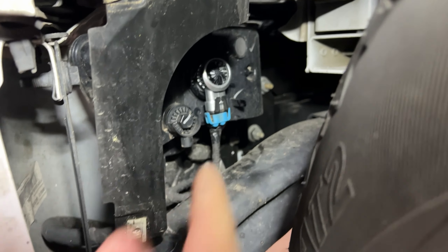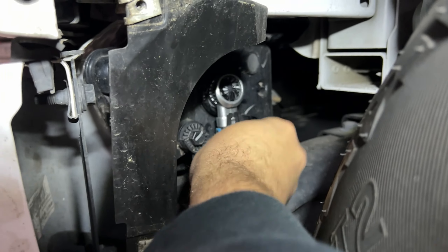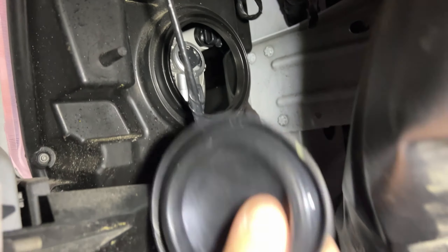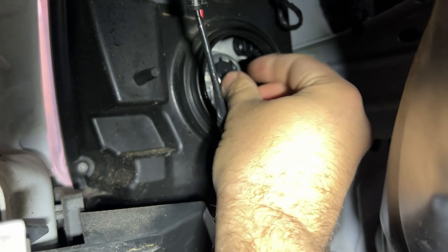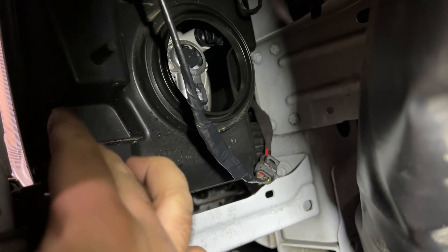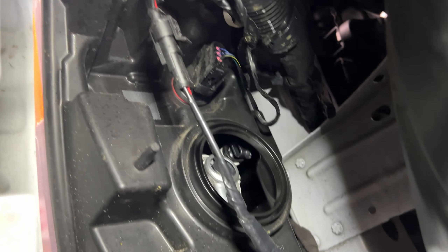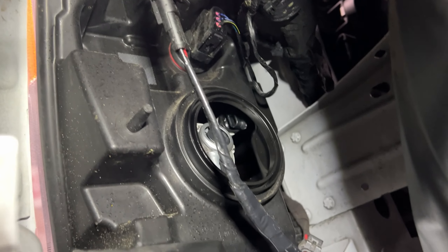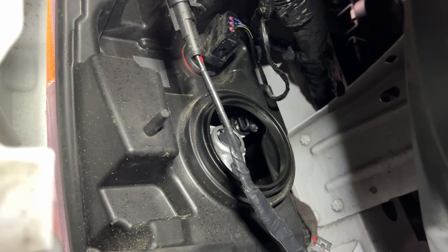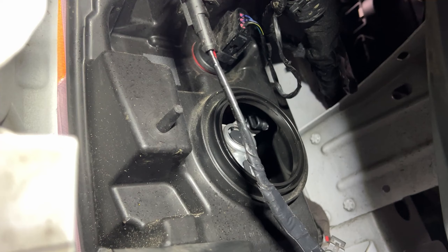The H10 is for the fog light — you unplug it, twist and remove the old bulb, put the new one in, and plug it back in. The rubber cover up top just pulls right out, then same process: unplug, swap the bulb, plug back in. The third bulb is further up and will be hard to film but it's the same procedure. I'll put it back together and show you how it looks, then we'll wait until dark and show you how bright they are at night.